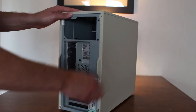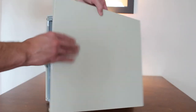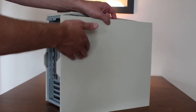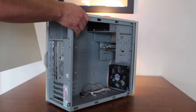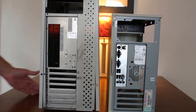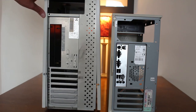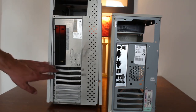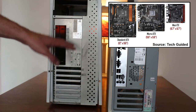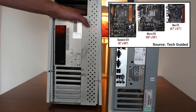I'll open this up — you'll notice the side just slides off like this, which is a pretty important detail. With this type of case, you only need to take off the side panel to get inside. A number of cases actually require you to take the whole top section off. This other ATX style case on the left is quite a bit larger — it has seven expansion slots, so it's a mid-tower large enough to accommodate a full-size ATX motherboard.